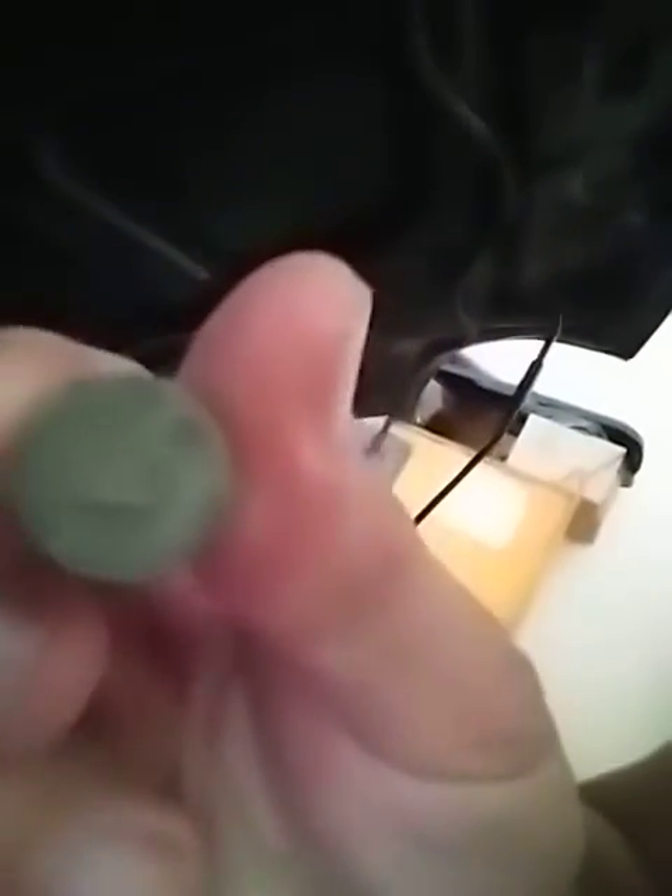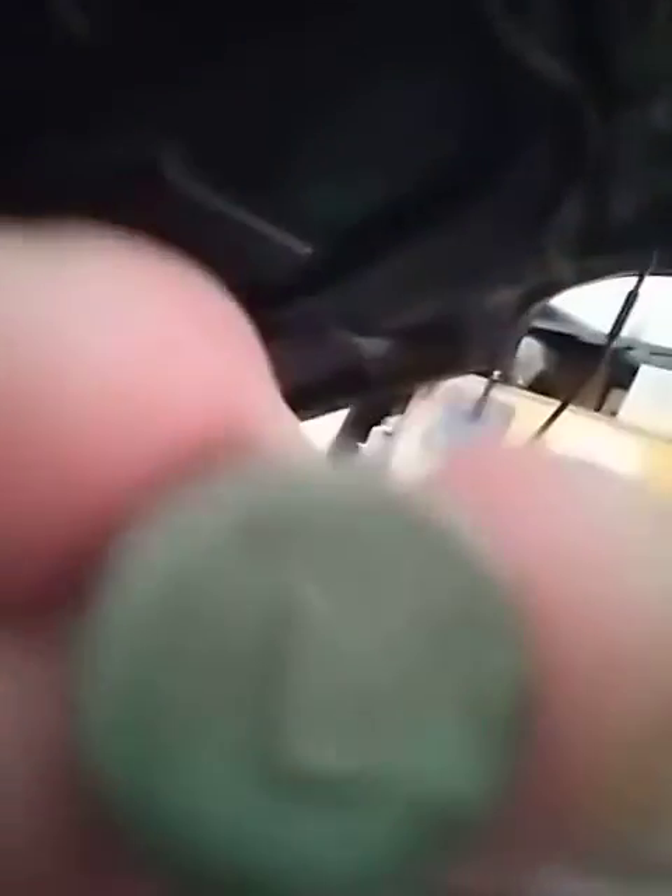Then you come over here and find the low side of your air conditioning hoses. There they are. You will see the low side — it just tells you right on top of that little cap. Low means it's got low pressure, and then there's a high one somewhere in there. Here are your air conditioning hoses right here. Every car is different, but they make these pretty accessible. It's really easy — just take your Freon that you bought at Walmart.